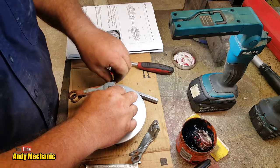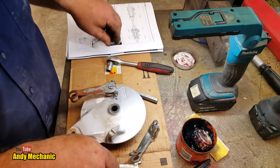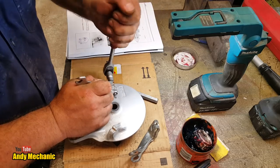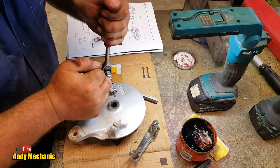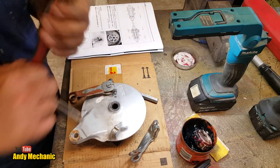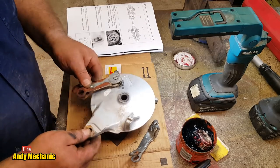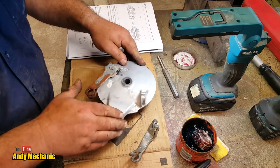To be fair, we don't really do drum brakes anymore, do we? There's not many out there. Most stuff is all disc brake. Now, the torque setting for this is 11 newton meters. That's not a lot. Click. There we go. Perfect. Manufacturer's specs. Right. So what we need to do now...